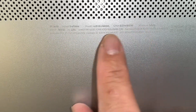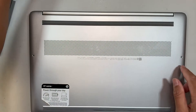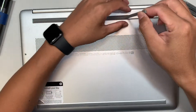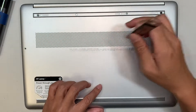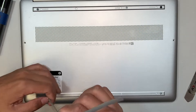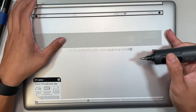I looked up the serial number to match the model number — I believe it reads EF 1044NR. Remove the two screws on the side, then get yourself a metal prying tool as we need to pry open the plastic. The plastic stopper covers the screws underneath, and there are three screws at the bottom as well, so let's remove all the screws.